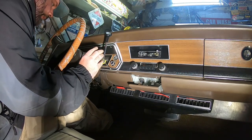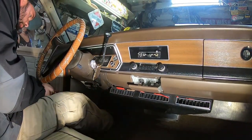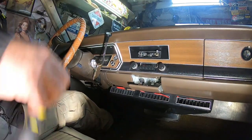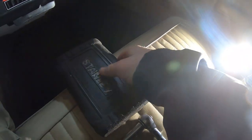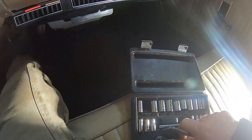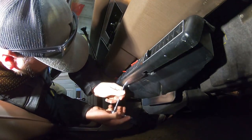I want to loosen the steering column - I don't want to break that. Feels pretty tight. I'll keep these to the right of the other ones. I just scratched my steel dash frame with my screwdriver - that's nice. Next up is get rid of these AC vents, and that is where this little kit comes in handy. The 10 millimeter fits really good on it.